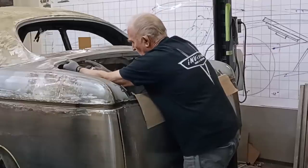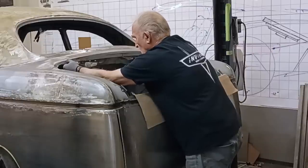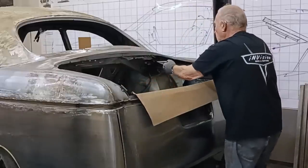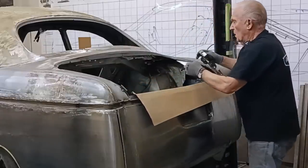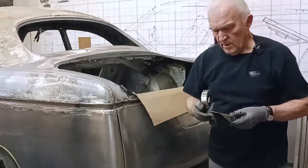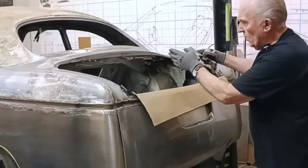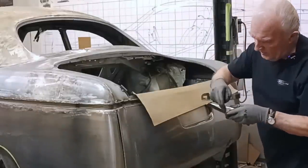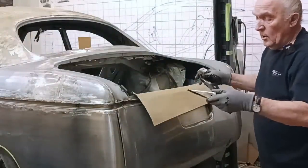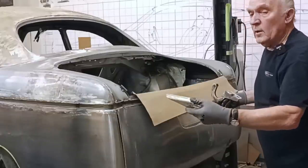It'll be clamped in nice and tight, lined up, welded in, and this is simply pinned inside like that. We've got both sides all ready — they're both notched. Now, being that the deck is kind of curved, we had to make one side of the channel a touch longer than the other side, so the inside legs are a little bit shorter and outside a little bit longer, so they sit nice and flat. You don't want them on an angle — any hinge operation has to be in line with the opposite hinge. If they're on an angle, they will bind.